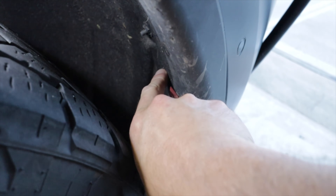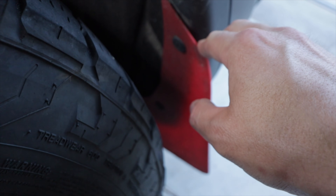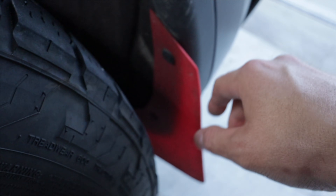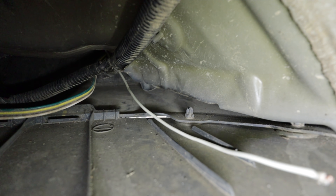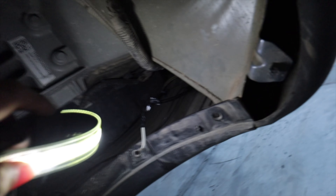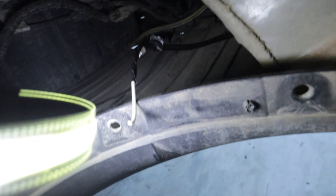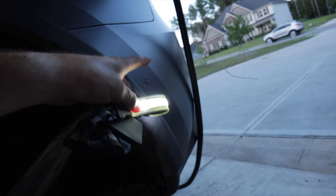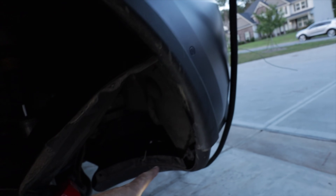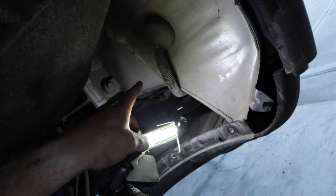Not the easiest spot — right in here is where I need to stick my hand. I've added mud flaps to this, which I'm actually going to remove right now, so that's a little bit of extra process. Plus, my car has way bigger tires on there, so there's less room here — it's a little bit trickier. But once I remove these, I can pull this plastic off. There's just enough room to fish the wire through from the outside down into here and find the wire. I grabbed another wire just to fish it through because in the Model Y the taillight is way up there, but the fishing point is down here. I was able to get the electrical tape on there and pull it through — this is definitely why you want to enlarge that hole.